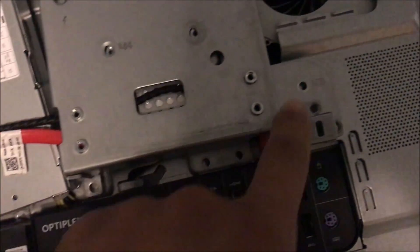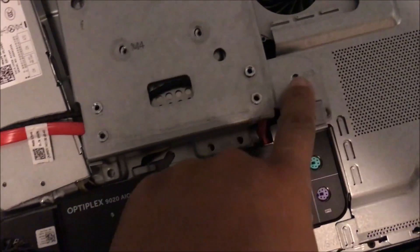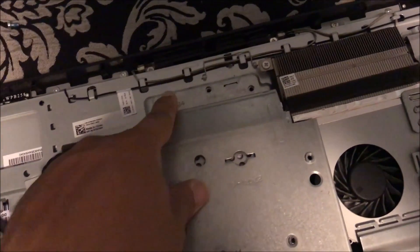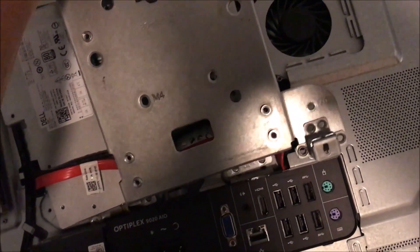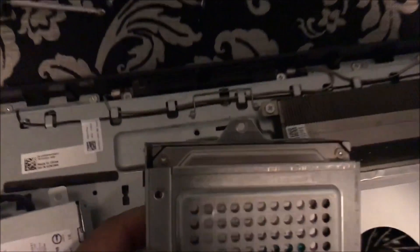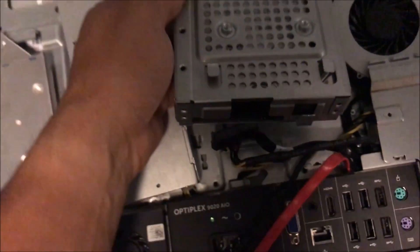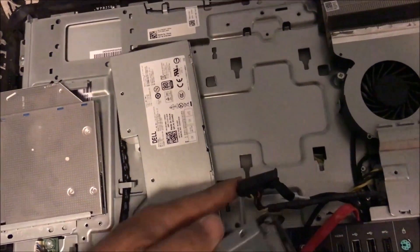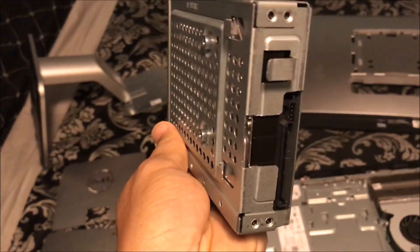Getting to the hard drive is fairly simple. Look around for the Phillips screws — there's one here, one here, three here, two here — and this plate just comes off. There's the hard drive. It's held down by a Phillips screw up here; remove that, then gently flip it on its back and remove the SATA cable and all the other power wires out of the way.